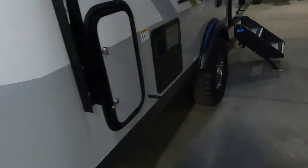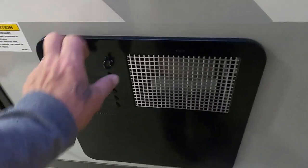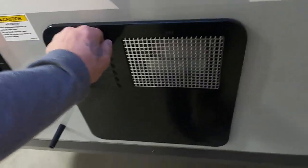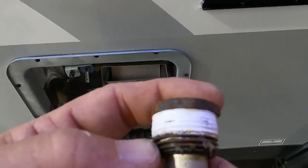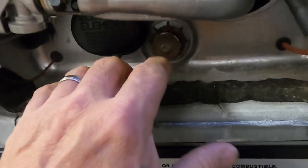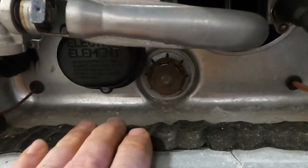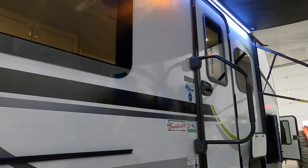Your hot water heater is going to be right around the corner here. And what we're doing at this point, folks, is making sure our drain plug's back in. Line that up right, pull it down. Take your rod, throw some plumber's tape around there. Tape works best, not putty. Putty will gum up on you. Get that in there nice and snug. Inch and an eighth socket. Once that's in there tight, you can go ahead and turn that hose on. After that hose has been on for a couple of minutes, I want you to go inside and open up all of your water lines.